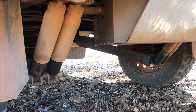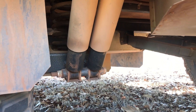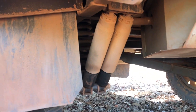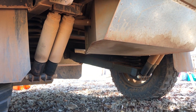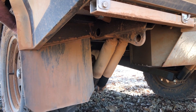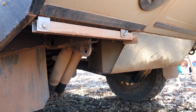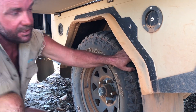It's got great suspension. The chassis is excellent — excellent weld quality and construction. It's coated inside and out. It's got really good independent twin shock suspension, and the suspension arms have all been finished with a hammer tone to protect them. All the wiring and plumbing is hidden up high so it's not exposed when you're off-road. There are good recovery points on the back as well. It's got stabiliser bars on the front and back — these ones are probably a bit flimsy for my liking, we've bent them a bit, but you don't really need a lot of support at the back given the way it's weighted.